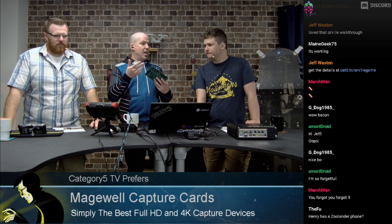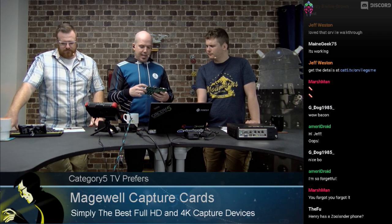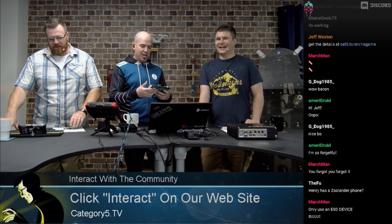I did try my standard power supply on this, like a nice Thermaltake ATX power supply. But this is only a 5-volt draw. There's no 12 volts, so it's not drawing enough. It's not drawing anything from the 12 volts, so my power supply doesn't show power good, and it doesn't power up. So then I thought, well, I could put some inline resistors to draw on the 12 volt channel and power up the power supply, but then I've got to mash up the cabling on my good power supply if I want to do it.